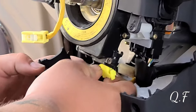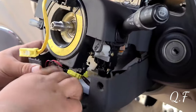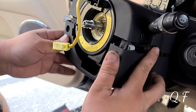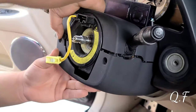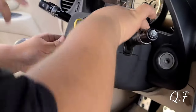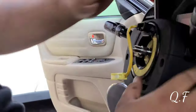Make sure you tuck the airbag resistor so it doesn't rattle, then put the cover back on with the three bolts, and then the steering wheel goes back on. It's not too bad — I think you guys could do it at home. It's a DIY — you just gotta get the Works Bell paddle shifter kit for this car. Everything's plug and play on that.